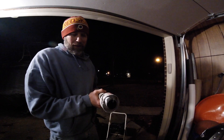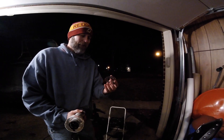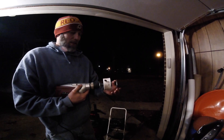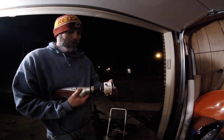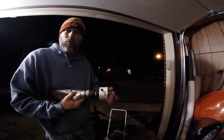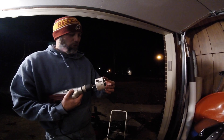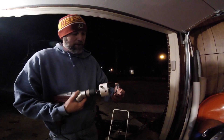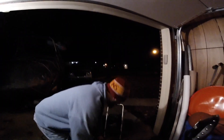That's going to hold your drill in place while you're trying to drill out this face plate. You're going to have to remove this face plate in order to break out the baffling. My wrist is still sore from the first one, so take a lesson from me and do this super slow and super light, because when this drill bit bites, it will stop and it's going to torque your wrist something terrible. What I would recommend, which is what I did on the bottom — it's going to go through the middle pretty quick, but that weld on the outside is super thick. So score it really good without the drill bit getting caught up.